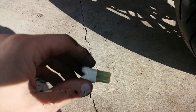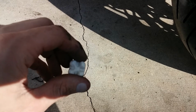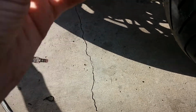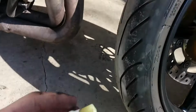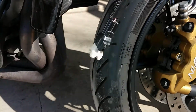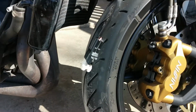So essentially, when you're, say, full throttle at 12,000 RPM or anything above the emissions standard, it sends a certain signal then, which is essentially just to allow the optimal air-fuel mixture, because they no longer care what the EPA says. So this will essentially replicate that signal. You can simply attach it in here to the harness, and then you wouldn't even necessarily need to go into the computer and eliminate the O2 sensor. And you could also leave it attached if you wanted. Now, this is what the previous owner did.